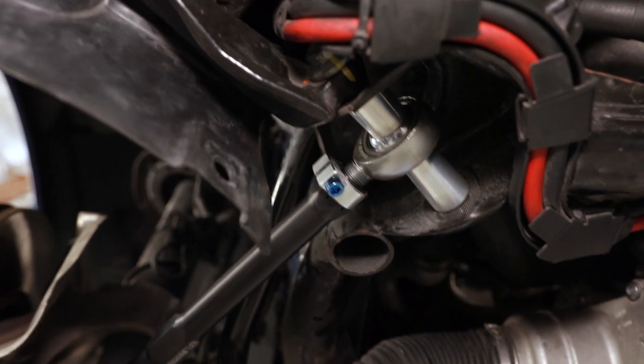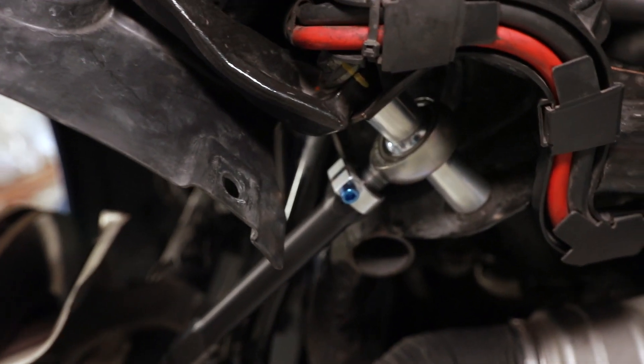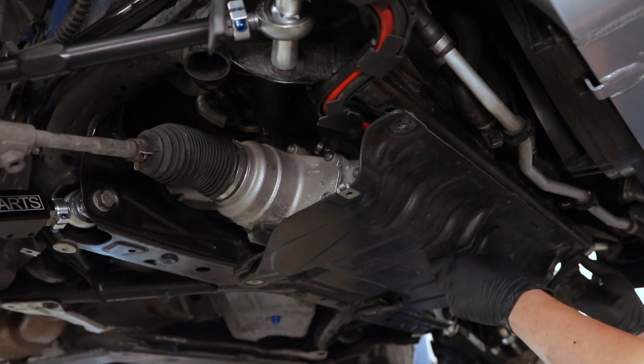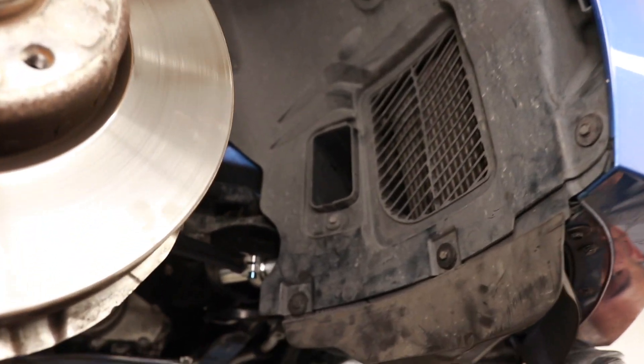The cool thing about getting the thrust arms done at a shop is that this locking collar here — we're not going to tighten it down just yet because we're going to put it on an alignment rack, get everything into proper fitment, get all the geometry right, and then tighten all the lengths down properly. Before we do the alignment we have to reattach the skid plate, the under panel, and the engine cooler covers. Stay tuned for the alignment video because we are going to be doing a giveaway there. If you want me to do a video on why it was so important to do the thrust arm with the control arms, let me know in the comment section below — and don't forget to leave a like and subscribe.